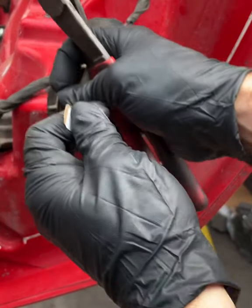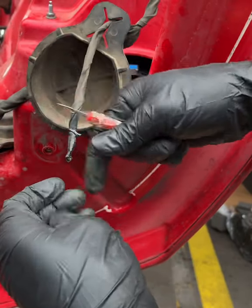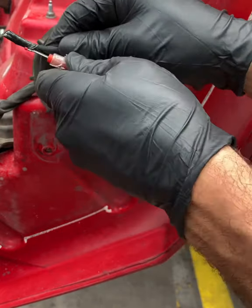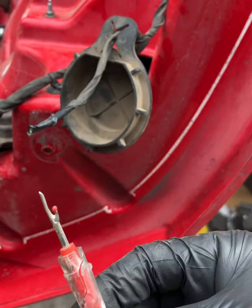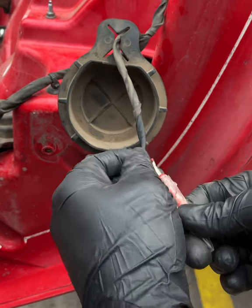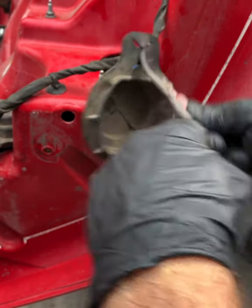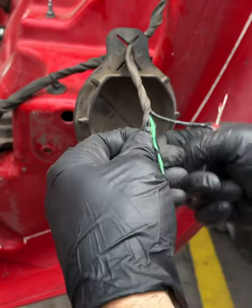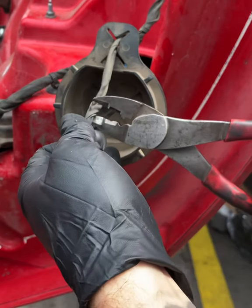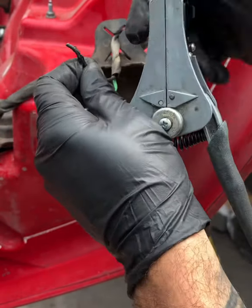What we're going to do right here is just kind of cut this open so we can see the wires. I got a seam ripper here which I got on Amazon or eBay — I don't know, one of those. It really helps out going through the abrasion tape and the black tape. Just get it started in there and you can usually just go rip. Sometimes you rip the wire and well, then you know what you got to fix. Pretty easy, right? Cut off the tape.